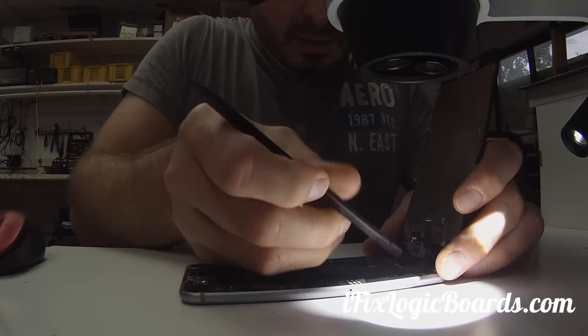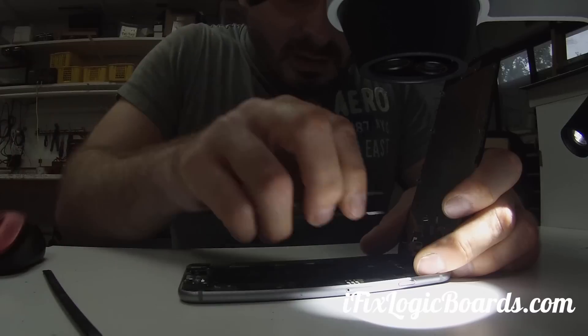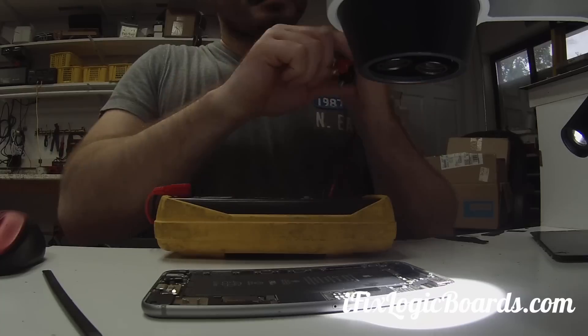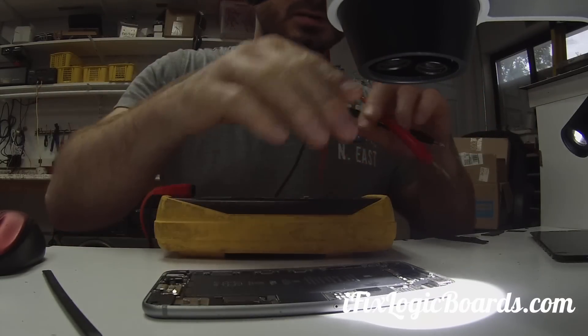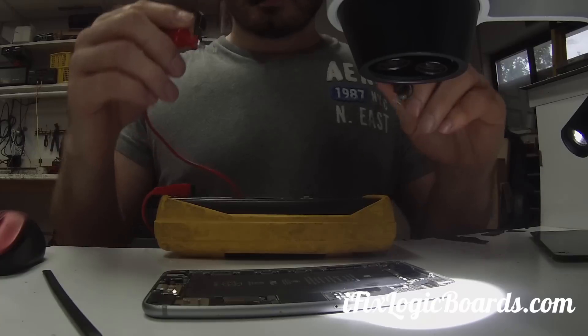So what I'm going to do is unplug it very quickly. The phone is still on and has power on the connectors. That's why you get burned when you're replacing the screen and you leave the battery plugged in — there's still voltage going. So if you cross your connector, it will actually shut down the backlight, and that's why you'd have no backlight.